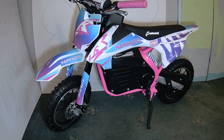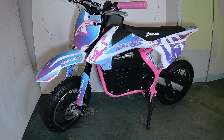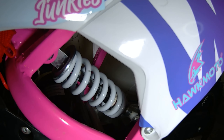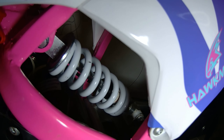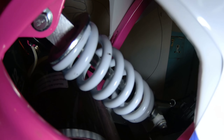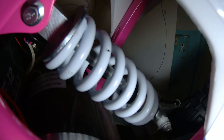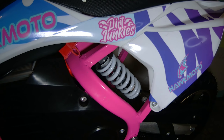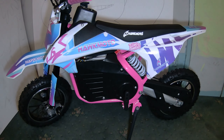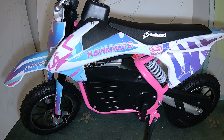The decals are finished, but I want to do one more upgrade before I ride it — a rear shock. When I sit on it it really drops and I imagine riding it would bottom out. I removed the shock and measured it — it's 195mm. I've ordered a 190mm shock off Amazon; it's an air shock with a maximum load of 1,000 pounds, so it's really strong and should do me perfectly. It comes this week — I'll do a quick video fitting it and then I'll be riding it, probably this weekend.